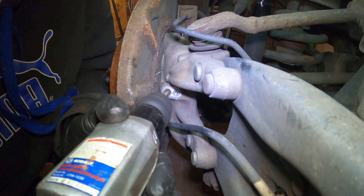So that's good. I'm going to remove these bolts here — there's two here, two there, they're just nuts on the back. It's going to be kind of hard to get to, so I'll get those out and that'll swing this free. The bottom two are actually really easy to get to — I just used my air tools and got it off. Even any kind of battery tools and you're good to go. The top one was a pain — I had to use a 17-millimeter shallow socket with a half-inch 18-inch breaker bar to break these loose because they're pretty rusted on there.